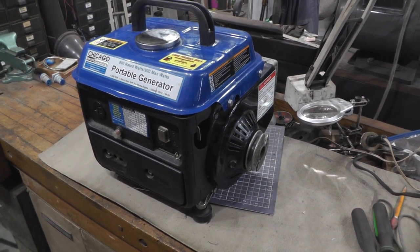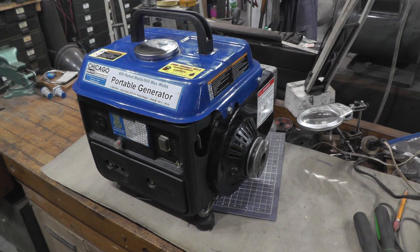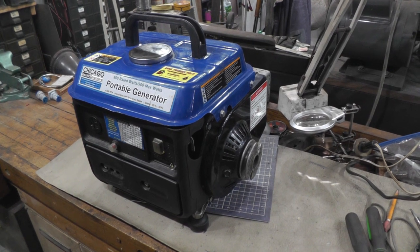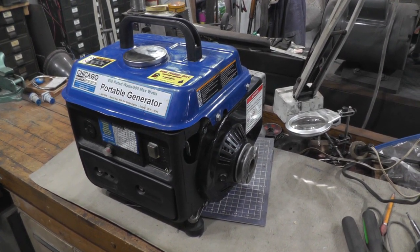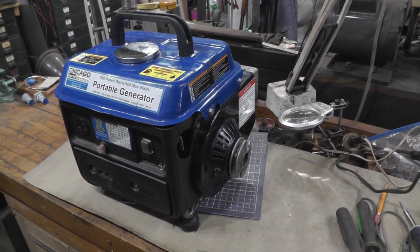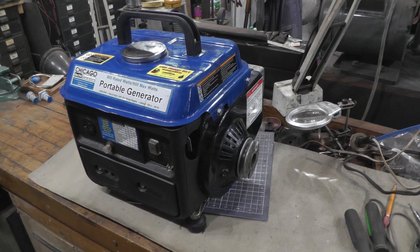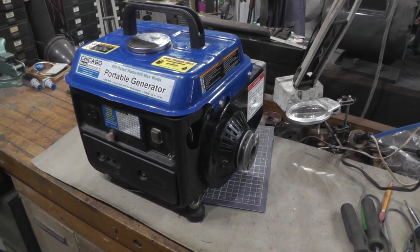The other ones I was able to save the starters because the plastic dog broke, and I made a pattern out of one that I glued back together, then made a sand mold and made some replacements out of zinc. They've been working well. Of course I'm careful with them — I don't jerk it hard and I make sure it's engaged before I pull it. They've always worked well.